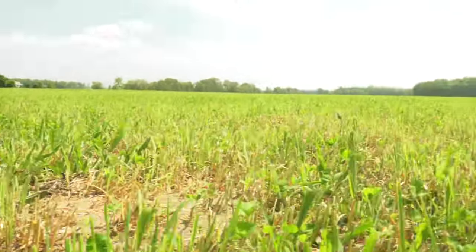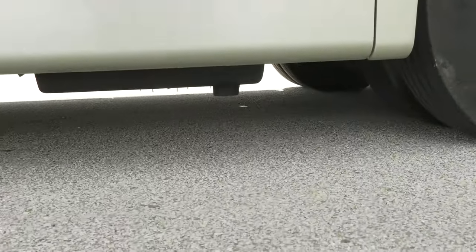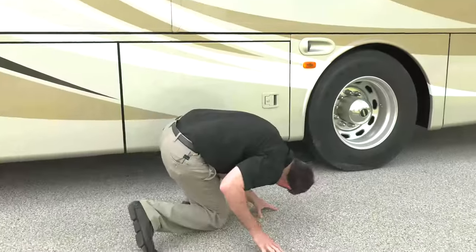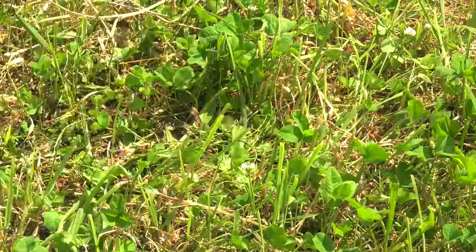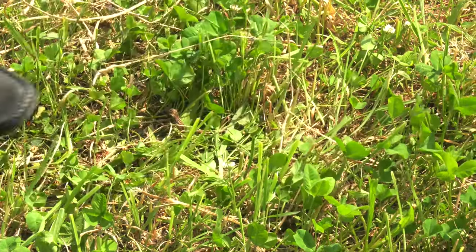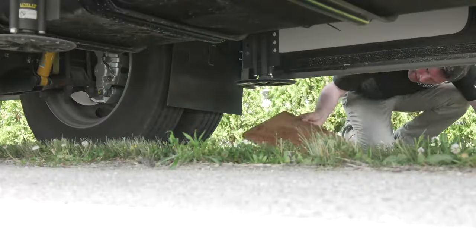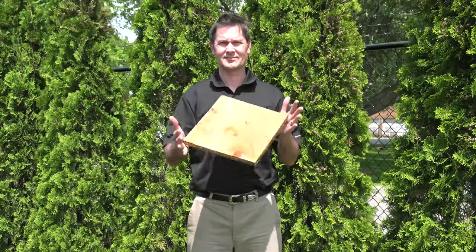It's not always possible, but try to park on a somewhat level surface. Before you put the jacks down, make sure there is nothing underneath that would get in the way of the jacks on their trip down. Check out the ground — is it soft? Is it soggy? Does it sink in? If the ground is soft, you can always put boards under the jacks to distribute the weight. A board 2 foot by 2 foot is recommended.